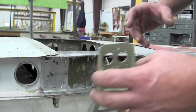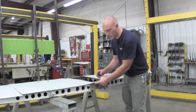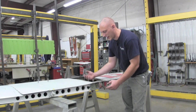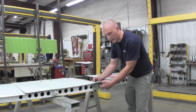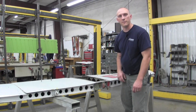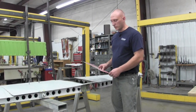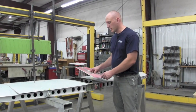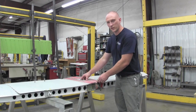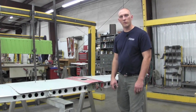Then you're able to install the box or brackets with rivets on the rear spar, and easily access with a bucking bar the tails of the rivets and access with the rivet gun to install those with driven rivets. Once your boxes are installed and riveted on there with solid rivets, you can then install the center section skin back on with solid rivets all the way around the perimeter of it.